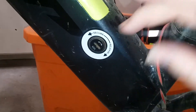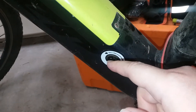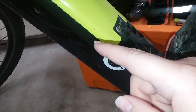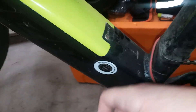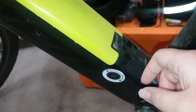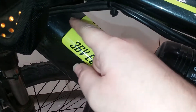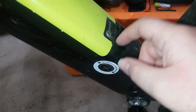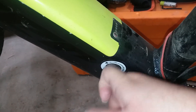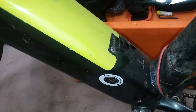There's a decent amount of cables packed inside here, so you'll probably be able to take that out and reroute if you want. I'm not sure if the connections for the speed control are connected down here or up here — if they're down here it'll be easier. To take out the cover, there are six screws: two on the bottom, two in the middle, two on the top, and then two screws to take off the plastic face. The two screws down here you don't really need to remove, just loosen and push in — that's all that holds it in place. Then it comes off pretty easily.